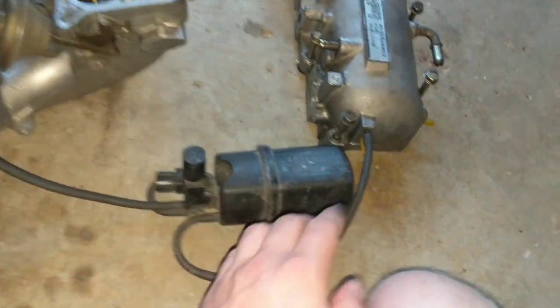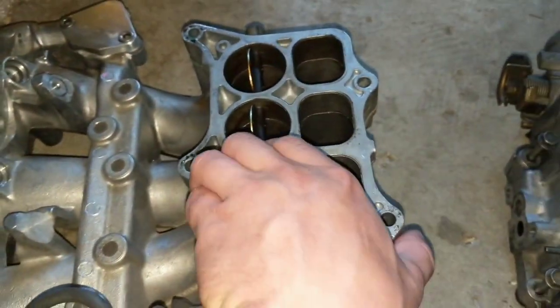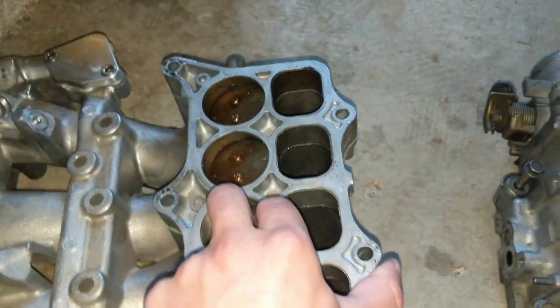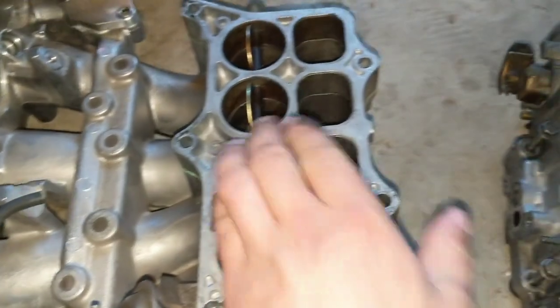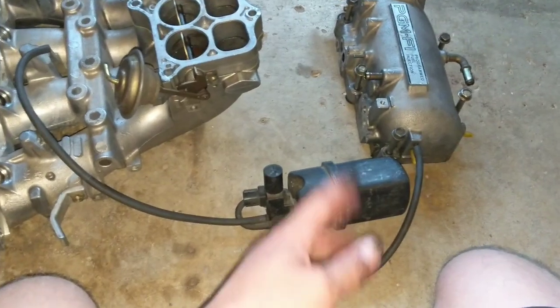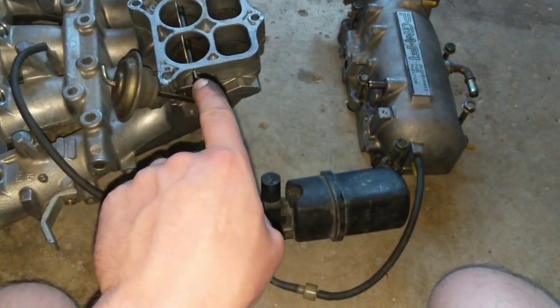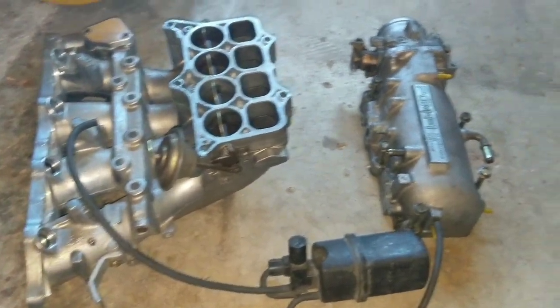The idea of the solenoid is to stop this air going from here to here, so this is going to be forced shut by air — very similar to how your FD works. And by itself it goes up quick. If I disconnect this, yeah — that's how fast it's going to react, it's really just an instantaneous open. That simple: plenum vacuum solenoid stops the vacuum, it opens, then vacuum closes it again — and that's how we make response out of a small displacement motor.